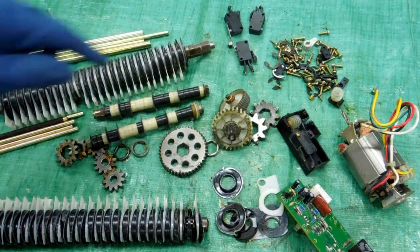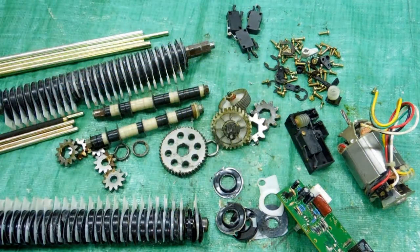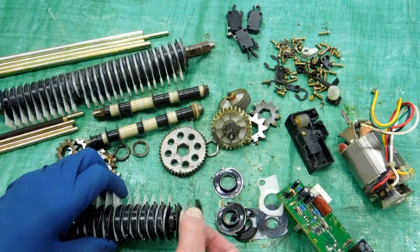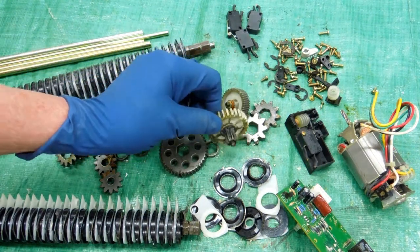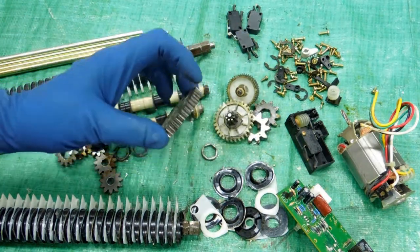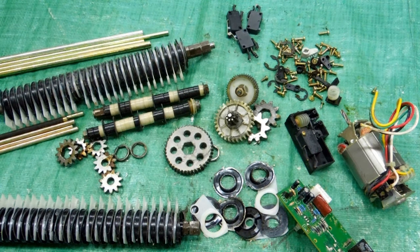Now it's all taken apart. This is where I get a lot of my screws, springs, retainers, and stuff for future projects. Four micro switches. Once you get the cutters apart, these will come off piece by piece — so if you had spare parts, you could repair this, but we don't, so we won't. The gear behind this nylon gear is metal, and it's running on this one — this is sharp as a razor blade. So that has been lapping the teeth in on this for as long as I've had the shredder. A little grease plus the application of some paper dust is probably a pretty good lapping compound.